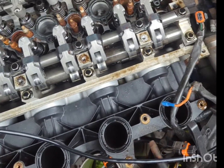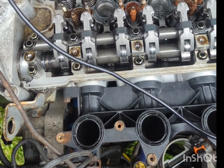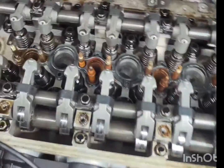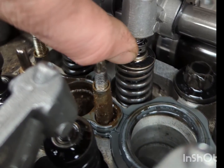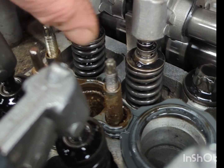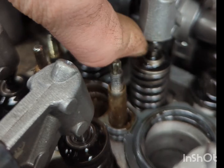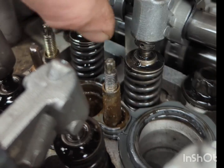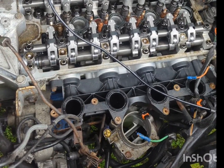Got the injectors out, got the rocker cover off. None of the valves seem to be dropped, so that's hopeful — it won't have destroyed the pistons or the camshafts. There's a tappet that's dropped out of place; you can see the next one is higher up. That could be an issue, but I don't think that caused the lock-up — it's just rattling around, just a loose sleeve. So hopefully it's bottom end bearings and I can just drop the oil pan.